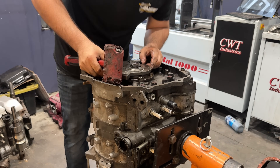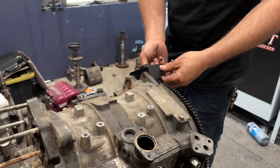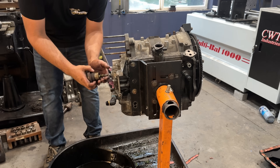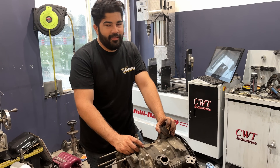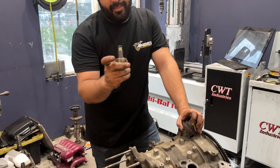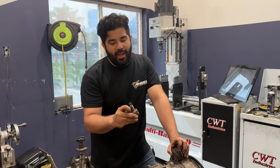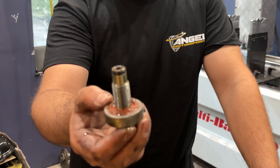They lacquered this in. When that one doesn't want to come off, you've got to put some juice on it with a long breaker bar. So this is the part where it's getting a little bit weird — the gasket and the red RTV. Somebody could have done it, but Mazda doesn't do this, so someone's been in here before. Mazda uses a grey sealant on every engine. This is exhaust RTV, so that means somebody's been in here before.